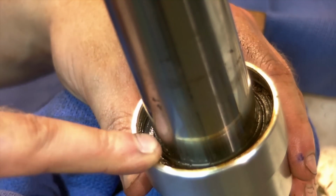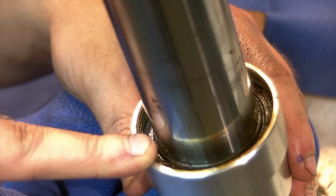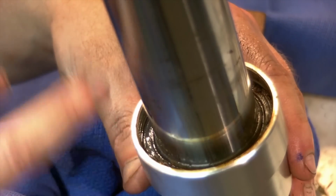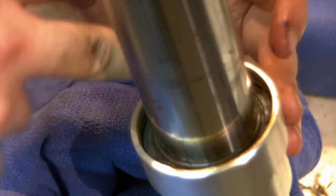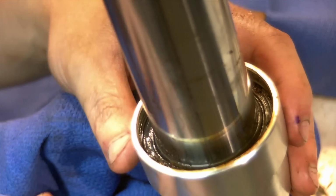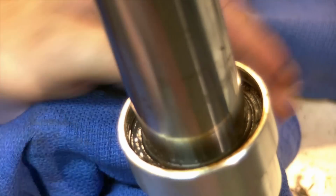If you're working on a 70s era motorcycle that's never had its forks opened up, odds are they're going to be glued in there. Other tricks you might even use is a little bit of heat, and I mean a little bit of heat, like a propane torch, just kissing it around this edge, mostly just to break up any kind of glue that's been going on between the rubber and the aluminum in this case. Let me reset the camera and we'll try the slide hammer method, see if we can pop this seal out.